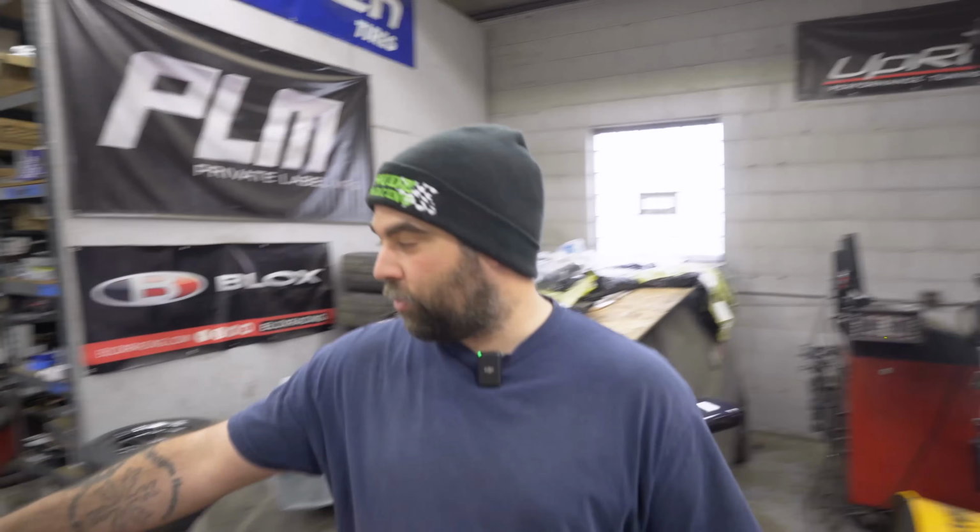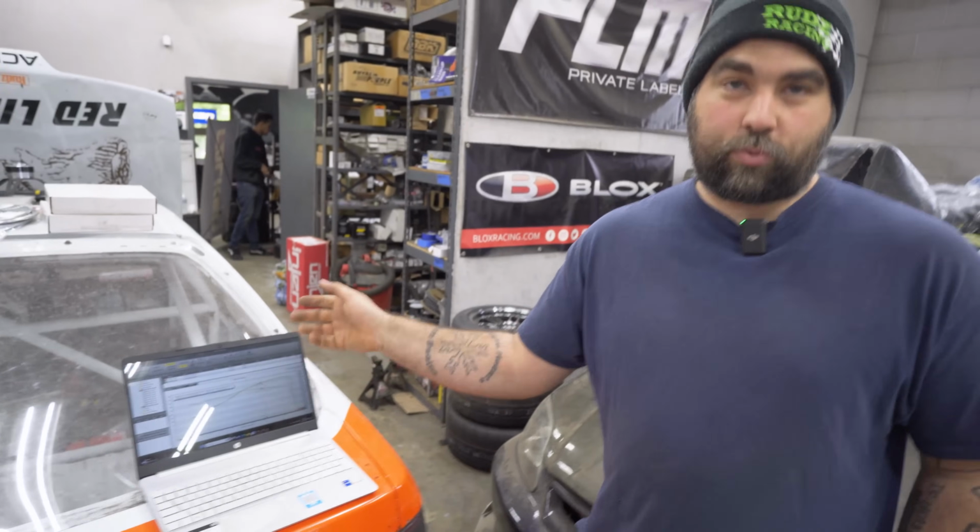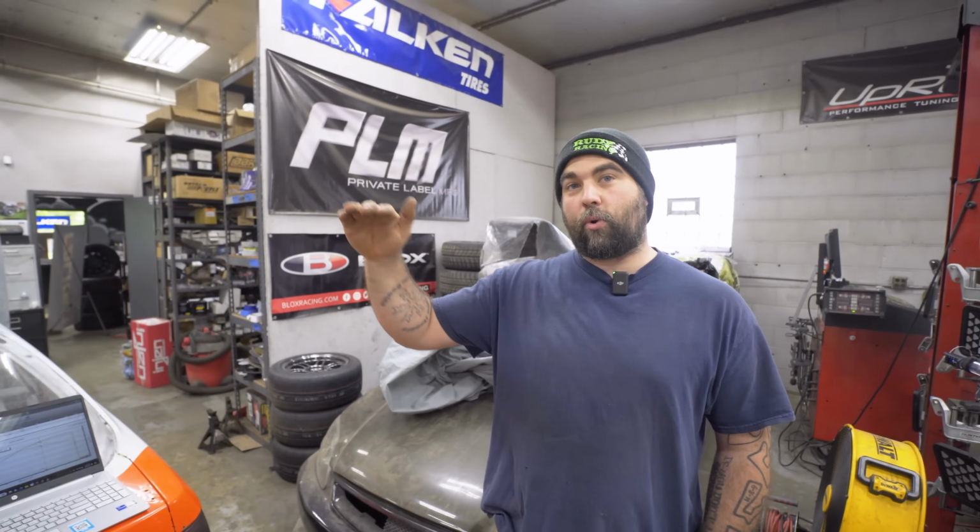There's many tuners in the world, Mikey being one, that can remote tune and get you pretty close. We saw that today. That base map was already kind of cooking, pretty on point. If you look at some of the middle ones, which we'll go through later, you'll see that he used the dyno to change where timing and fueling came in, because you saw where it picked up versus where it didn't pick up. So he made those changes, and he could because he had the dyno to see the data. We made 222 like 7 times in a row, but where you're getting the pickups matters.